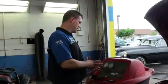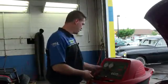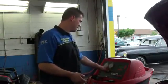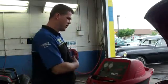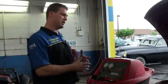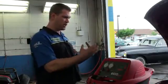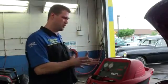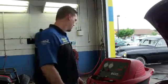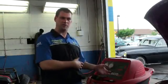The vehicle is now filled with Freon — two pounds, which is what it's supposed to take. We're going to turn our gauges off so there's no pressure feeding back through. You'll still be able to see the pressure in the vehicle on the gauge because you're just closing the valves to prevent anything from spraying out or causing a problem. Always turn the gauges off, and then we're ready to fire the vehicle up and test pressures to see if we're done or if there are further issues.